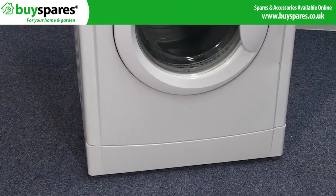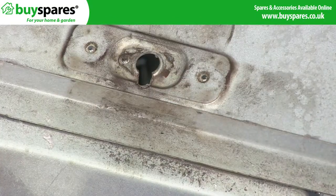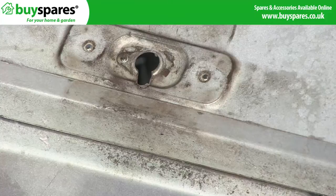This can be a common problem with many of these tumble dryers. As the machine ages, the bearings can wear and eventually cut through the shaft.